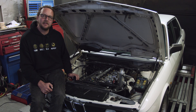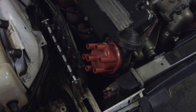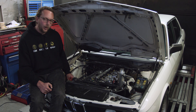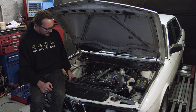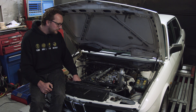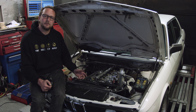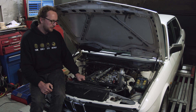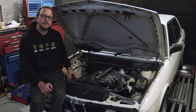The first thing you'll notice when we look at this engine is that there are no high tension leads or spark plug leads hanging off the end of the distributor cap. This is because we've converted this engine to direct fire ignition, meaning we've got one coil firing one spark plug per cylinder. The distributor is still in place because we're using the signal from it, as well as a new trigger wheel fitted on the crankshaft, to give us a full direct fire trigger system. The ECU sees engine RPM off the crankshaft and engine position from the signal now in the distributor.